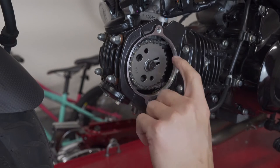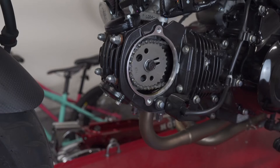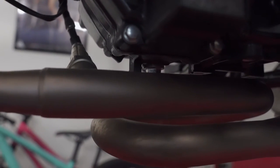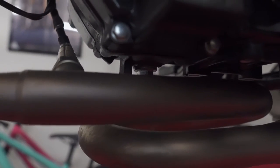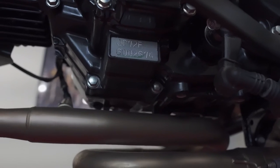The cam gear needs to come out, but first this nut needs to be pulled out and we need to loosen the cam chain tensioner. But I do not see a cam chain tensioner. One of the amusing things I always see on forums is somebody who went to change the oil on their Grom but ended up backing out the cam chain tensioner bolt instead of the oil bolt, and the spring comes out and they don't know how to put it back in. In this case, I only have a single bolt and that one's for the oil, so it appears on the 2022 there is no cam chain tensioner bolt.